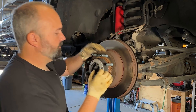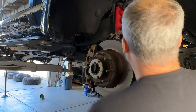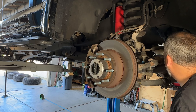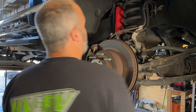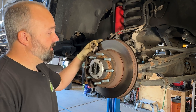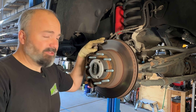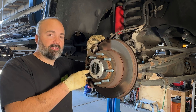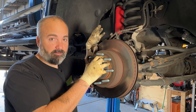You can also run your hand across your vacuum line here — that's actually the actuator down through the seals — and just make sure as you see it running up into the engine bay that you don't see anything chafing, broken, or rubbing. Hopefully it works while you get out on the trail. We're going to clean the corrosion along the inside here — it's not really a big deal. Eventually these rotors are going to get replaced. So I also like to shoot a little bit of lube in there, not enough to get onto the rotor face, but enough to help inhibit some of this rust in the future.